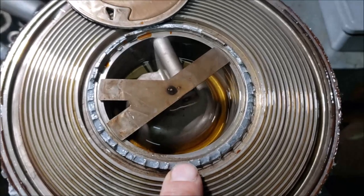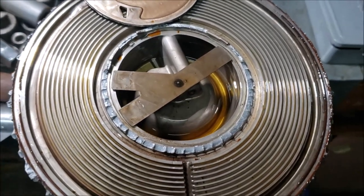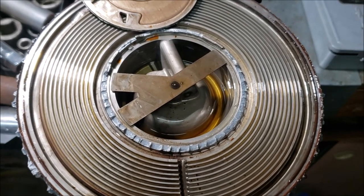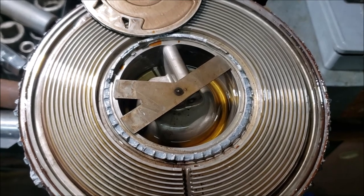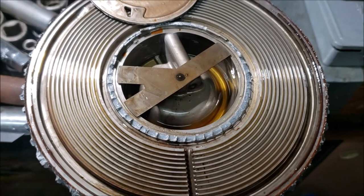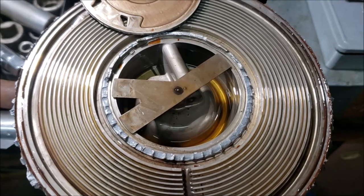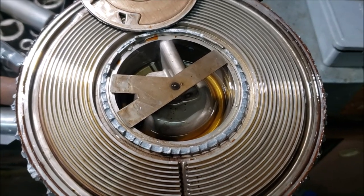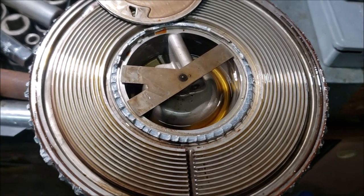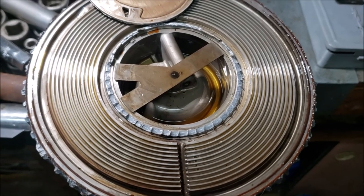One thing I noticed: there's very little oil in here, and I think that's the problem. I think over time the oil just gets out somehow. I've seen other videos of other types of clutches like this that are actually serviceable — you can unbolt them and add oil, I believe it's a type of viscous silicone oil. But ours is completely sealed from the factory, so you'd have to beat the thing apart to service it.